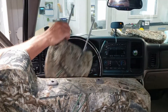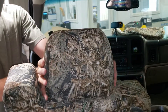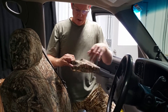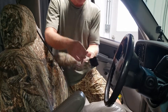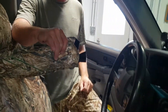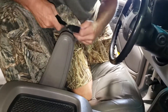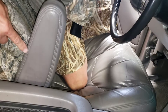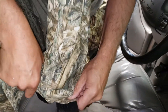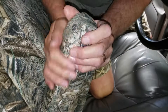Recline the seat to make it easier to get the headrest in. Next, install the driver's armrest cover. It kind of looks like a slipper, with velcro at the back edge. Carefully open that up — on the inside it's labeled DA for driver's armrest, or PA for passenger's armrest. Kneel on the seat, flip that armrest up, and line up the seams of this cover to the seams on your armrest — we just copied what the factory had.